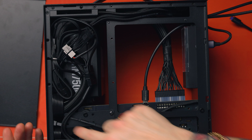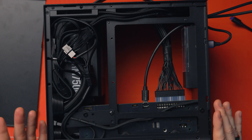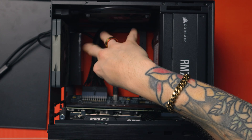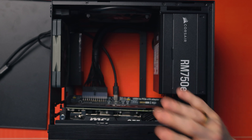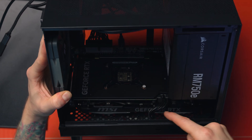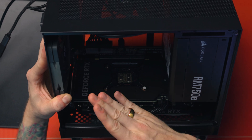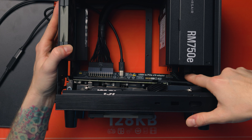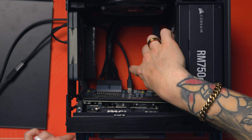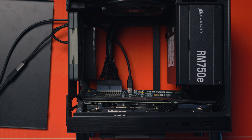Routing the cables was the biggest challenge because I wanted it to look neat. If you don't care, you could just dump cables in the empty space where the motherboard would normally sit — it might impede airflow a bit but it's not a huge problem. The graphics card is secured to the UT3G and the power cable comes around to power the GPU, and because it's cocked at a slight angle it gives more relief from the power supply cables.